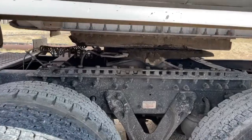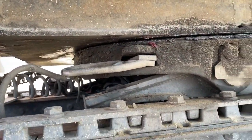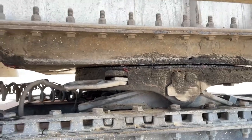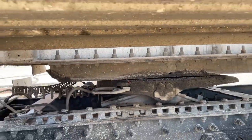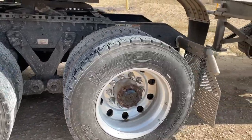While I'm thumping tires on this side, one thing I love to check is making sure your fifth wheel release lever is all the way in, suggesting that your kingpin is locked in. I know that sounds simple, but we've seen it where it's not fully locked — and that's a great way to find out.